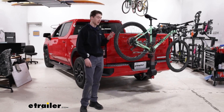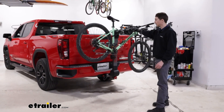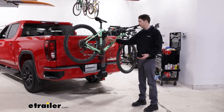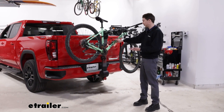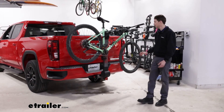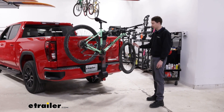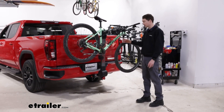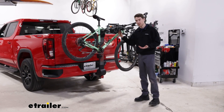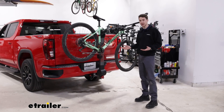The Ridgeback is a hanging-style bike rack, which means it holds onto our bikes primarily with the top tube, and it's got one anti-sway cradle in the back to help keep some of that movement out. As with most hanging-style bike racks, you're going to get a little bit of that back and forth movement. This front tire is free swinging, so I definitely recommend picking up some sort of stabilizing strap to keep that in place. It does have the ability to hold four bikes up to 40 pounds apiece, and it's got a couple cool features that we'll check out throughout the video.